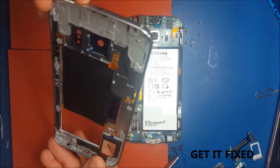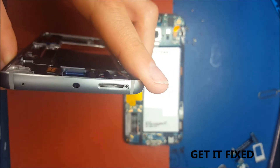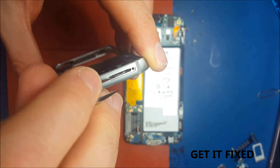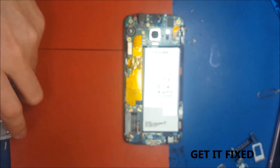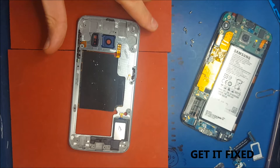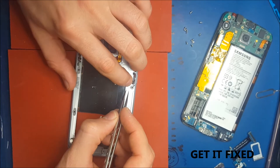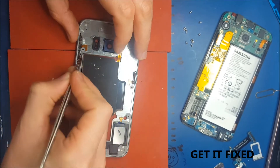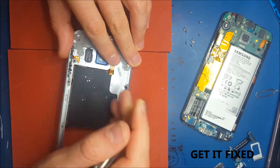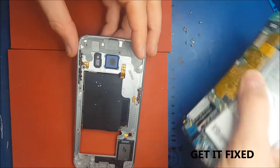What I have here is quite a new one, definitely not a genuine one. It looks like a Samsung S6 Edge bezel but it's just a copy — it might be from China. The outside quality is quite okay. My concern is about the speaker, because many times I have to replace the whole bezel since the speaker is just glued into the frame, so it's quite difficult to take out and you can damage it easily. If you have any problem with the buttons or the flex cable, that you can change with no problems. Even the back camera lens you can change it. But the speaker is quite difficult to replace.